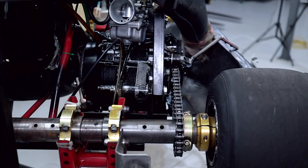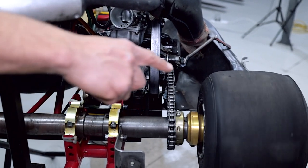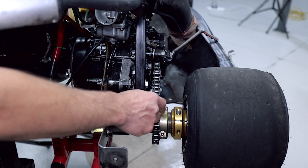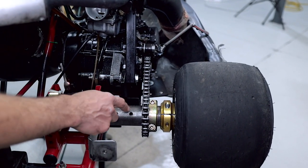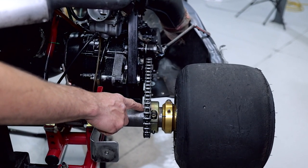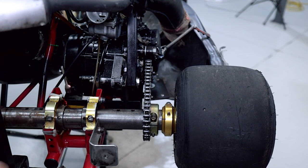This particular car has come in and you can see the wheel rotating out of round — it's bent the axle. I believe it could have been from an impact. Otherwise, I think just the torque of the engine, having the sprocket so far outboard, may have tweaked the axle. So we're going to beef that up a little bit while it's down here.